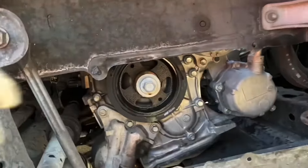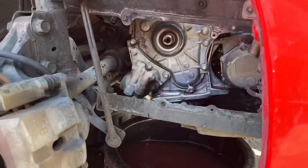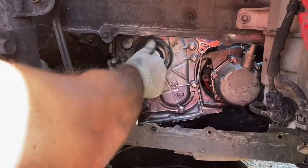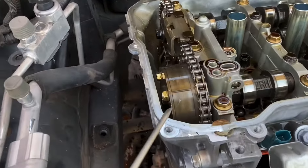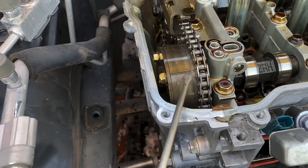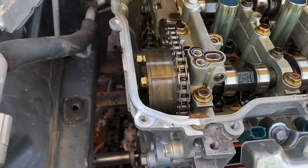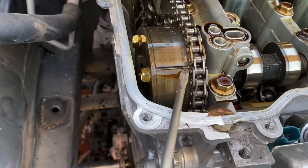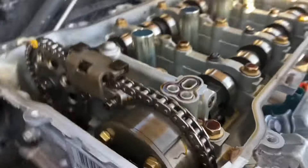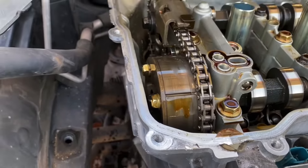Okay, the oil's finished draining. Now take the rest of this bolt out and remove the harmonic balancer — you're going to need both hands, just reach around behind it like that. We're going to put the crank bolt back in but not tighten it up, just so we can spin the motor. Now we are going to set the timing. The easiest way to do this: when you're looking at the timing marks, see how this line right here does not go all the way to the chain. He's going to use a half-inch ratchet and the 19 bolt to spin the engine — we're looking for this mark, the long mark with the extra notch that hits the chain. We want that, as you're looking at it, to be at about two o'clock. That's how you know the engine's at top dead center.